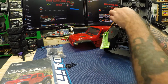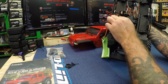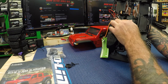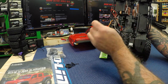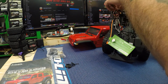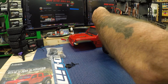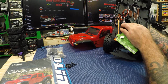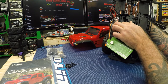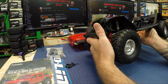There's our body — that's a big body, a lot of space in there. There is our two-in-one ESC — it is the Firma Spektrum Firma 40-amp smart ESC, with the bind button right on the top. The wiring is all zip-tied together pretty nicely. We've got the little connectors for the auxiliary lights, and we also have two auxiliary outputs open in the ESC so we could add additional lighting from there.